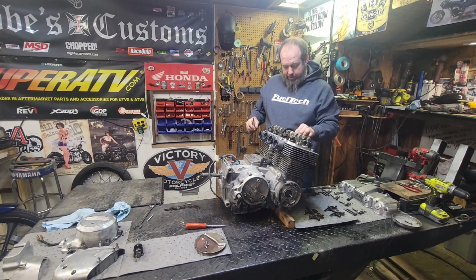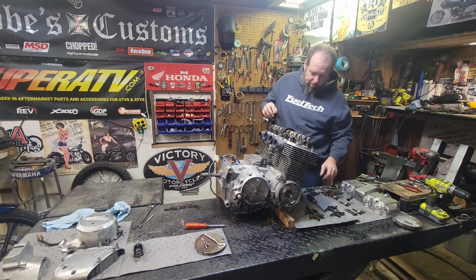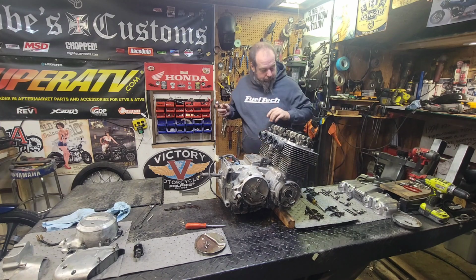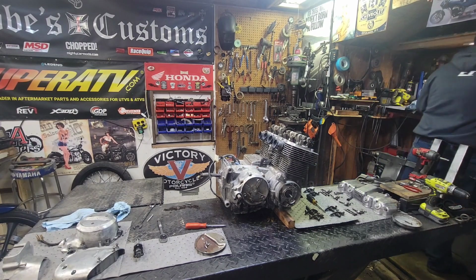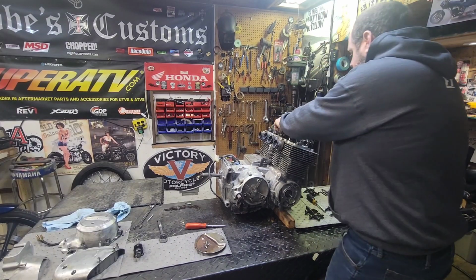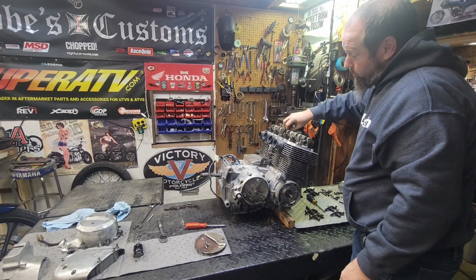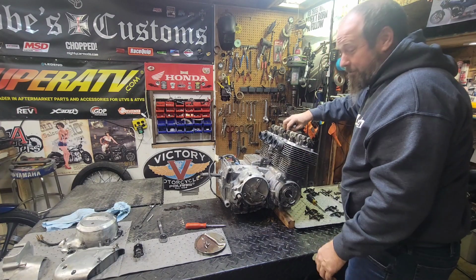Okay. Camshaft is now free. We can pop off the bolts up here, pop off the sprocket, and then slide the camshaft out. Here we go. Need to get a good 10mm wrench over here and pop these loose. They're usually torqued on there pretty good because these two bolts hold everything. So taking it apart and putting it back together, these two bolts are crucial. Very crucial.